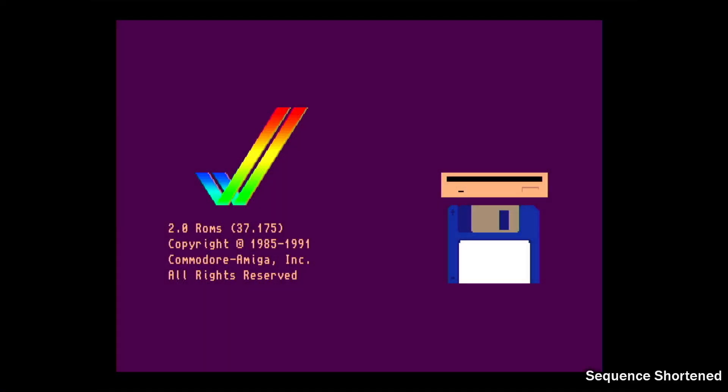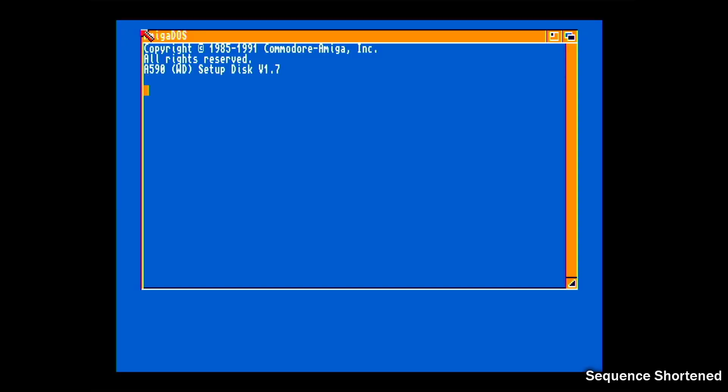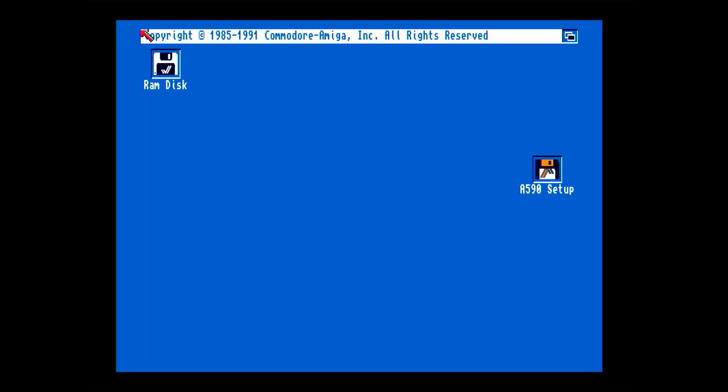I'm going to try this with the A590 boot disk again with autoboot disabled. Interestingly, like this the drive LED now comes on and it's no longer locking up or crashing on boot. But once we get into workbench there's still nothing new. Now the drive could be faulty but it does sound as if it's actually trying to work. And I'm still unsure about that SCSI drive controller chip replacement. So it's still not working — no drive appearing. And if I go into HD Toolbox it doesn't find a hard disk drive either.